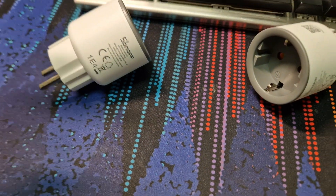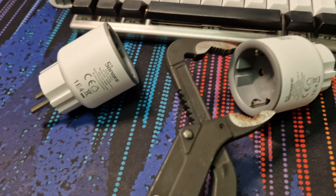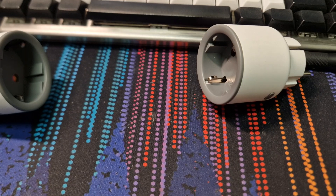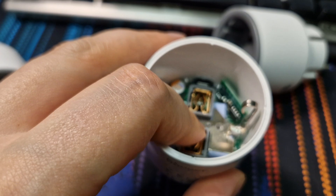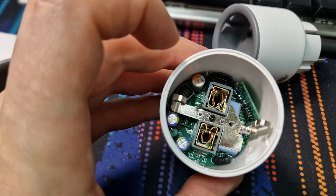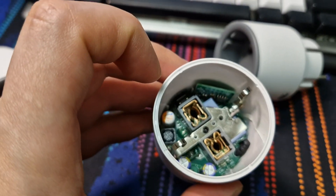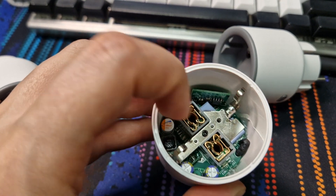It is fairly easy to do when you just grab the gray part and squeeze. Once it's broken there, you just turn it and do it, turn it and do it, until this is free and it lifts out. Once that lifts out, you undo this screw because the gray plastic wallet can come out with it. It is clipped to the PCB, so take out that Phillips screw, then desolder this point and lift up the bracket. Grabbing the leg with tweezers through the legs and pulling up while heating the joint makes it easy to lift off.